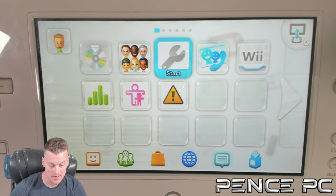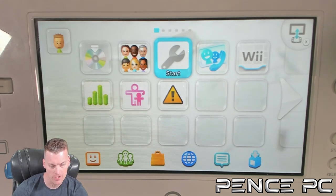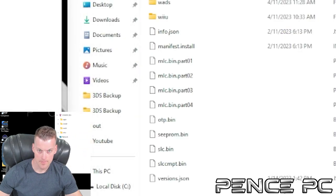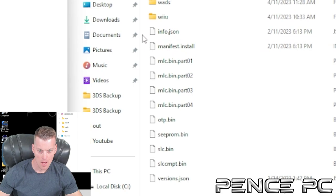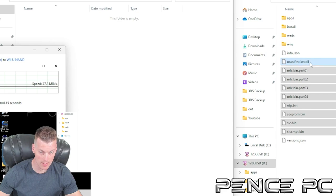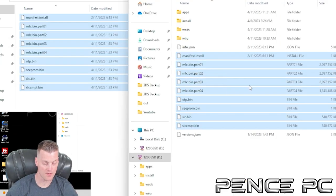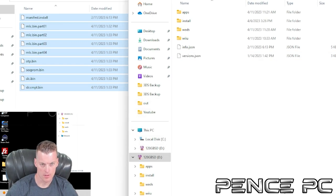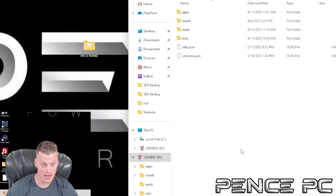After your NAND is copied to your SD card, it should reboot your console. Once it does, power down your console and put your SD card back into your PC. I created a folder on my desktop to back up the NAND from the SD card. Here is my SD card — all of these .bin files. Select them and drag and drop to your computer. You can keep them on your SD card if you want, but they take up a lot of space. Now that we have the NAND backed up, take your SD card out and put it back in your Wii U.